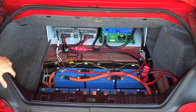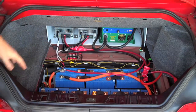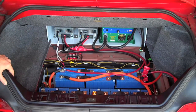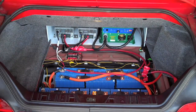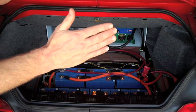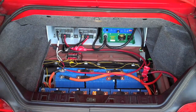The charger is set to charge the pack to 168 volts — that's 3.5 volts per cell. Once it gets to 168 volts, it starts to ramp down the current and then eventually turn off. After half an hour or so, the surface charge wears off and they've all leveled out to about 160. I can go through and measure all the batteries and find that they're all the same. At this point I've seen no need whatsoever for a battery management system, as long as you keep it within the window of the sweet spot for where these batteries operate best. Don't overcharge them, don't overdrain them, and everything works out fine.